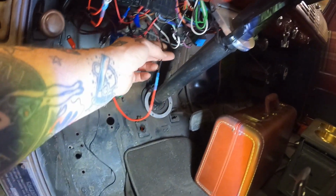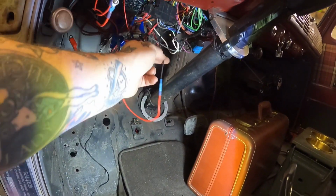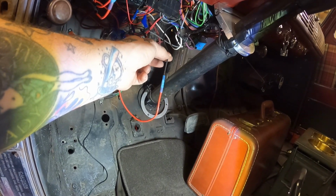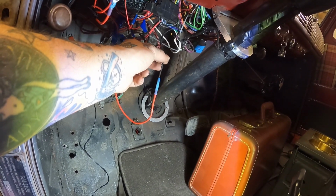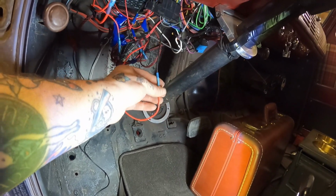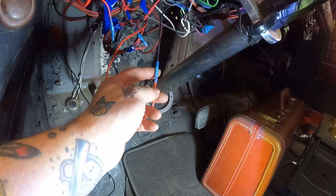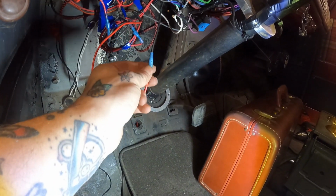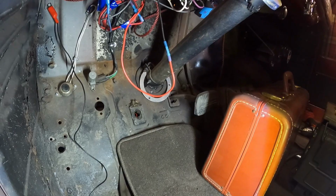All right. Tied into this cluster of wiring, which is an aftermarket wiring harness. I found one wire that is not being used. It's on its own fuse. Everything's good to go. It only operates on ignition. So I tied in a fresh wire that I'm going to run for the LED lights for underneath the seats. Just put the connector on there, heat shrinked. I love these little heat shrink units. They're really nice and clean.